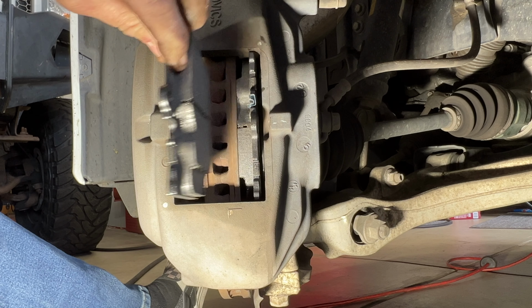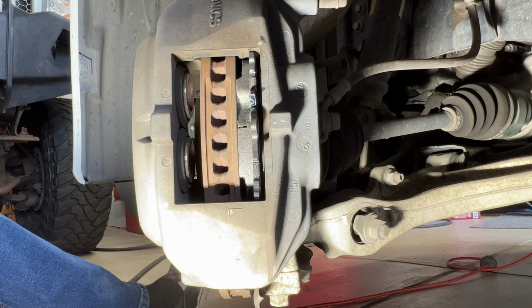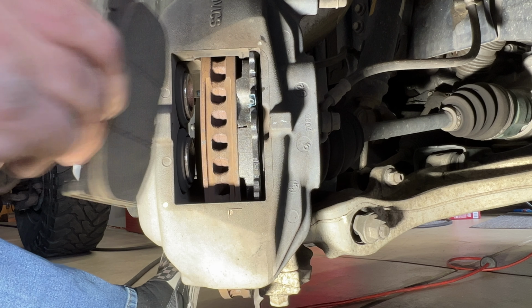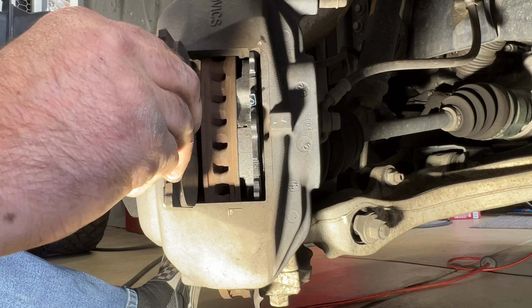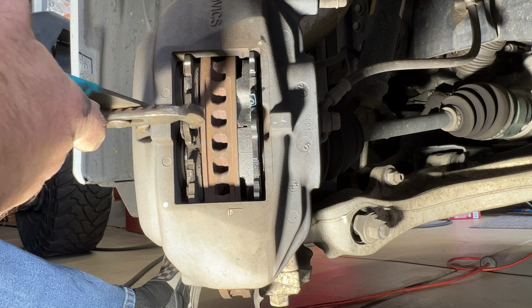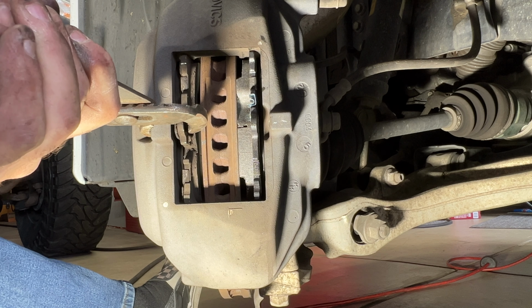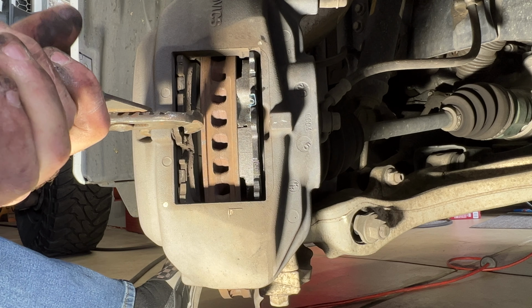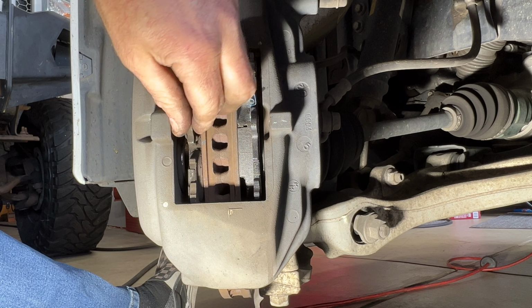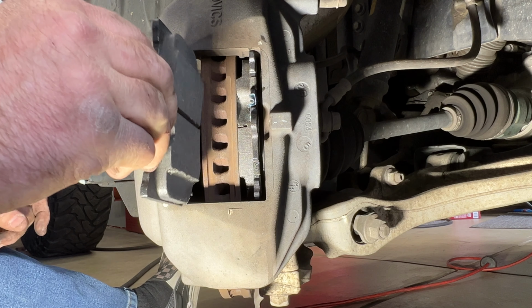So it looks like it's not going to fit, so we need to compress those pistons in a little bit. So I'm going to take the old pad and just kind of slide this in. Use my channel locks here again, and let's squeeze on this. Try to get that pushed in all the way. Take this back out, and let's see if that's going to be enough.